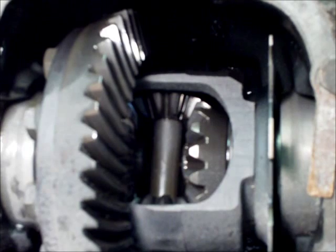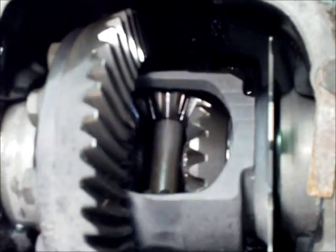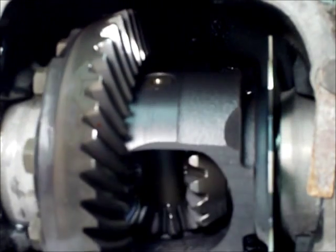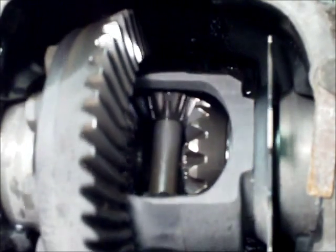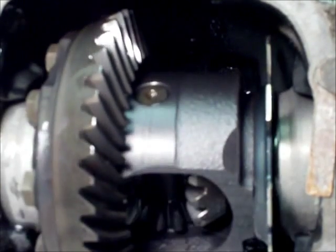To give a supplement of what I had before, I'm going to show how the insides of the open differential work from an outward perspective with better lighting. Right now I'm only spinning the input shaft from the driveshaft — so under regular straight conditions, this is all you will see. Now I'm going to hold one axle so that it doesn't move, simulating a slip situation. You can see how the spider gears actuate, spinning the other axle while I'm keeping this one stationary.